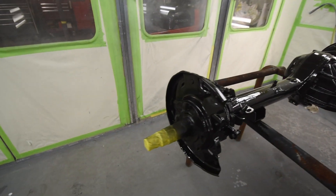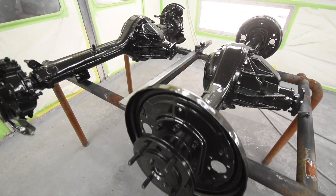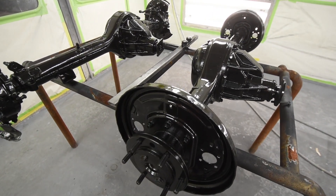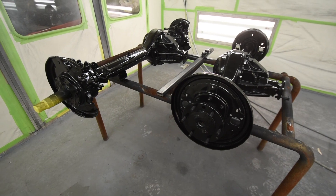Here are the axles. These axles are going to be having the disc brake conversion, and as I said the other day, this is the rear axle and we're just waiting to have that conversion come. We're going to unbolt this and basically take the other one — we're using this as the pattern. So we're aware that the backing plates are still there; those will be removed for the disc brake conversion.